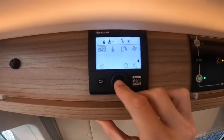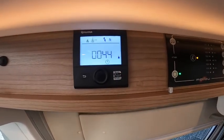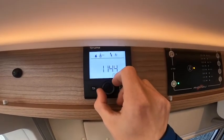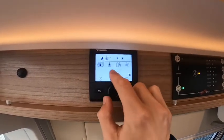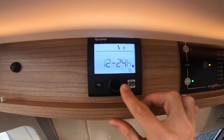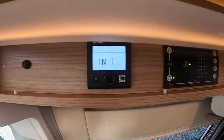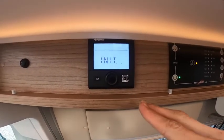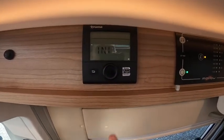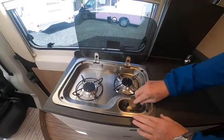In the bottom corner you've got a timer so you can set the heating to come on and off. You can set the time on the main display panel — useful when clocks go back or forward. Should you get a warning triangle, go to the settings spanner, select Reset, press Enter, press Preset and it will restart the control panel. You'd then re-enter the temperature, water setting, energy source and fan speed. To turn off, just hold the button and it'll turn completely off.